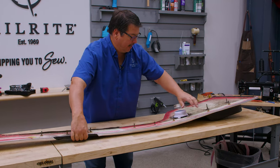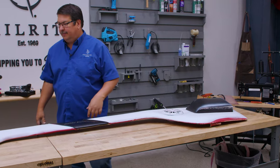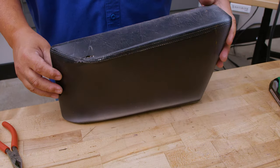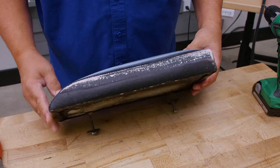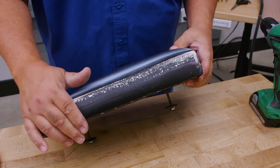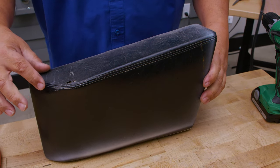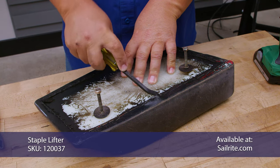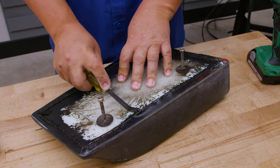The first thing to do is take off the speaker and then remove this piece. This piece just had some bolts, lock washers, and washers. The top piece is sewn in, and on the bottom they just pulled it over and around. Because we're going to use a four-way stretch vinyl, it should enable us to pull this around the perimeter. We're going to create a separate piece for this section. The first job — which I don't like doing — is removing the old fabric via the staples on the backside.